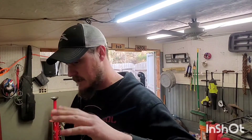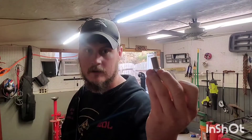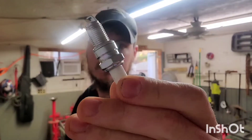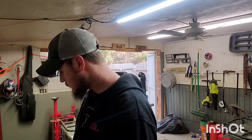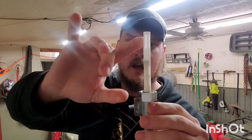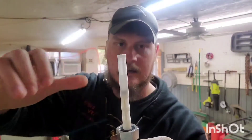Welcome back to day two of working on the customer 300. Got some parts in last night — basically all the parts I need to put the gas tank back in and hopefully stop the fuel tank leak. Also got the new ignition coil and a new spark plug — these are temporary cheap Chinese ones. I've got four legit NGK plugs coming, but this fills the gap as a known-good spark plug tester. For the fuel tank, got the nice screens to keep rust from getting into the actual petcock and into the fuel system.